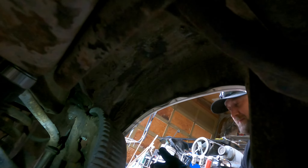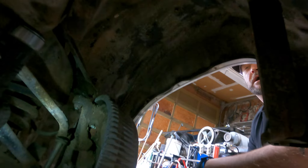Jason is removing the cotter pin from the ball joint. We will be disconnecting the upper ball joint to drop the spindle down, and then praying to God it doesn't hurt somebody. The size of socket I used was a medium large socket — also known as an 11/16 socket — and it comes in black.